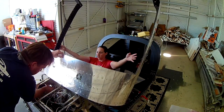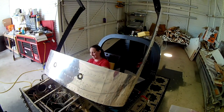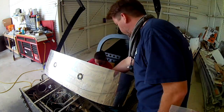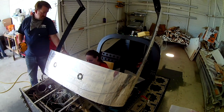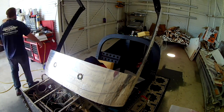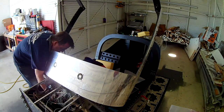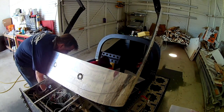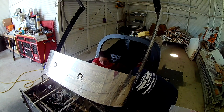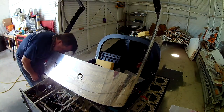Label right on either side of where the wires go toward the wings — as wires go from the center tunnel into the wings, label everything right there. Label right before they go into the grounding wires, and right as they come from the back of the sub-panel. Those are the areas where you're going to be manhandling crap-tons of wires, and if something breaks you need to know which one it is.